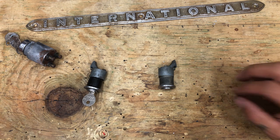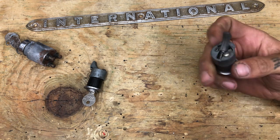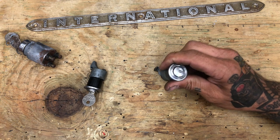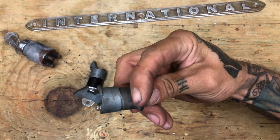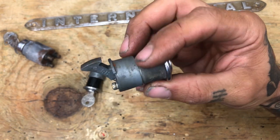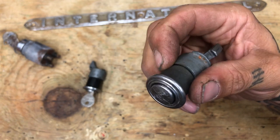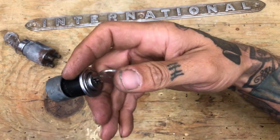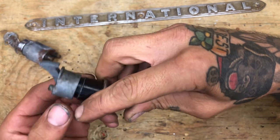Here's a quick video about how to get the most out of your glove box button. This came up because I saw a guy on Facebook trying to figure out a way to get a locking glove box. Obviously you can add a lock to your glove box if you want to, but what a lot of people don't realize is that you already have one. This is a glove box button latch for a 40s through 50s International truck — probably out of a KB. The same kind is in my S120. This is a non-locking button — no lock on it, just a button. This is the same thing except it is the locking kind. Key up, it's locked; quarter turn to the right, unlocked.